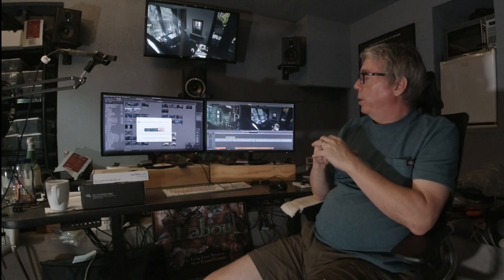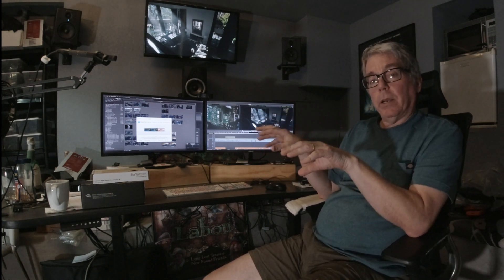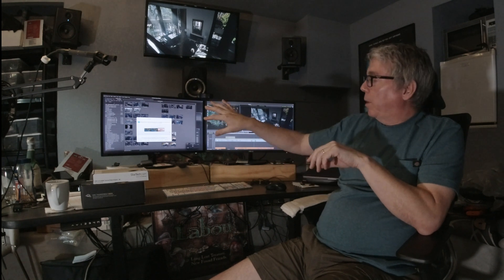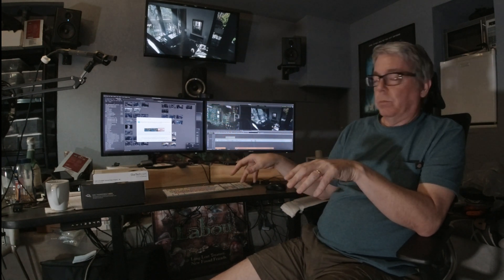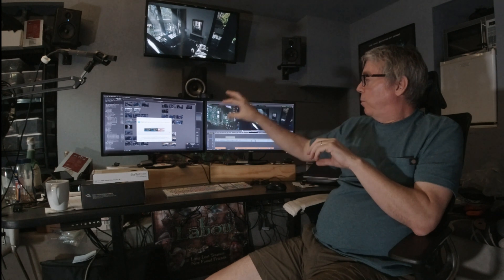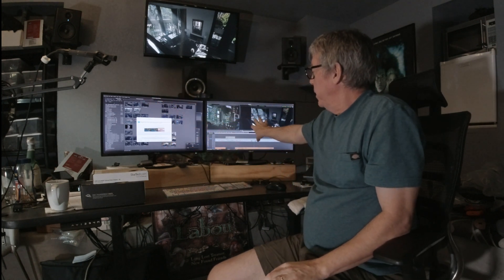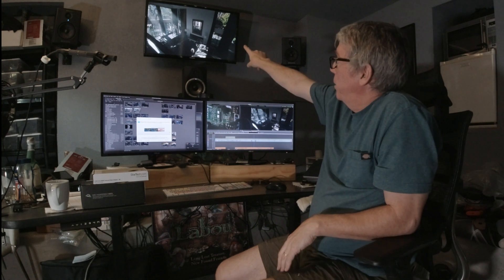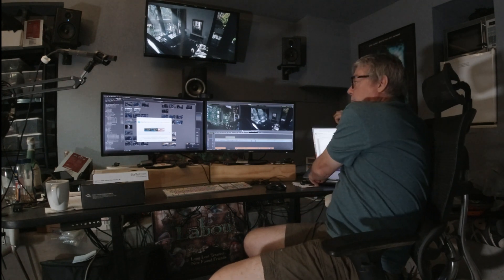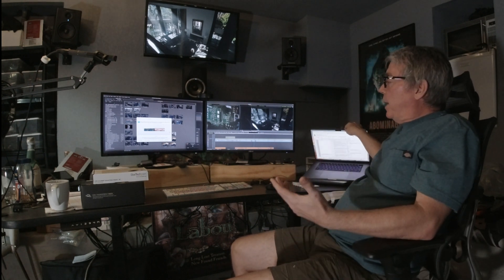The one thing I did have to do was go through the initial setup of these monitors. When I first plugged everything in, all four monitors appeared, but the system showed them all as mirrored — all four displays were showing the same thing, which was the desktop. So I had to go through the process of picking which monitor was the primary, and then where each monitor fell in the chain. As it is, this left monitor is my primary monitor, which has the menus. This is the next monitor in the display chain. My client monitor is the third in the display chain. And then when I open the clamshell, you'll see a fourth monitor appear, which is the laptop. Once that was set up, it seems to stick.